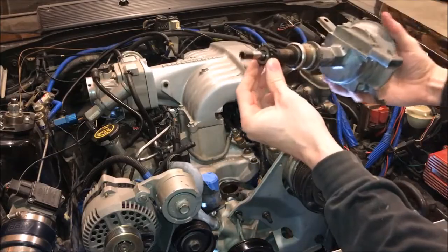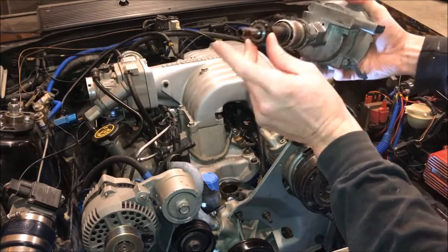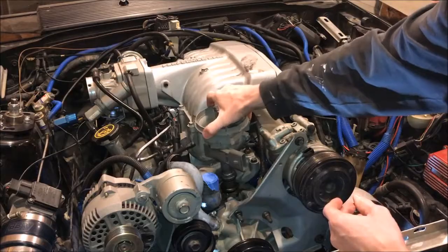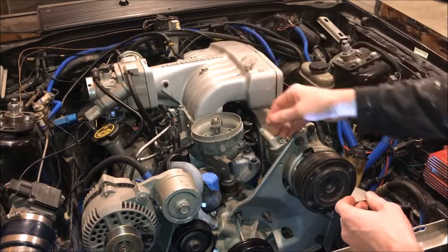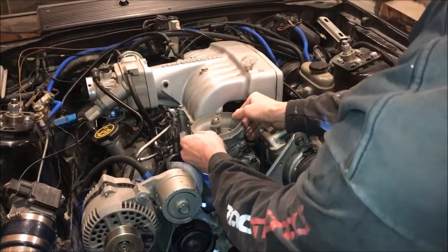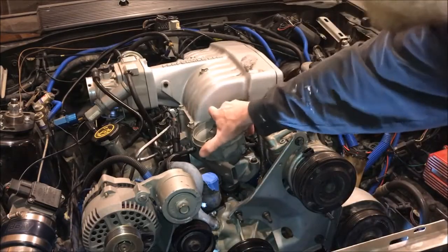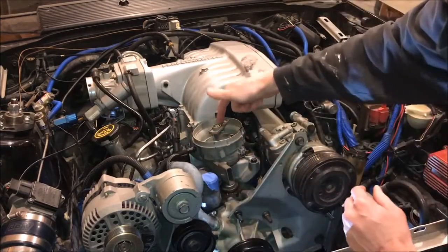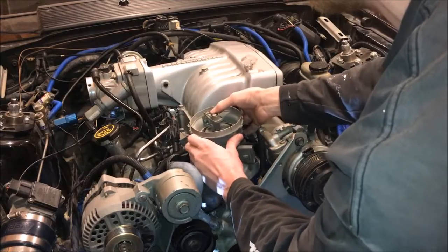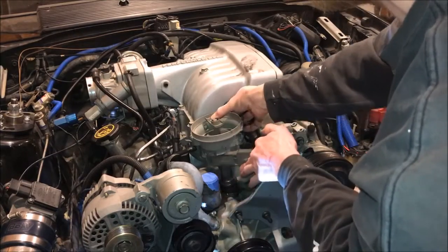You can see the gears down here. This slot connects to your oil pump rod, and the gear will seat in place as well. Sometimes you have to finagle it around, but it will go down. When I let it go it likes to fall, so we just need to press it down. There we go — we need to check that the rotor didn't click over when it dropped in. It needs to stay where we had it marked. So we'll spin the distributor just a little bit and try to seat it a little differently. There we got it down.